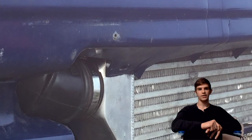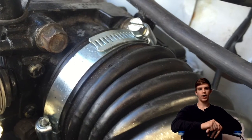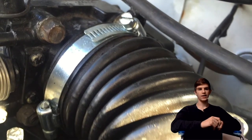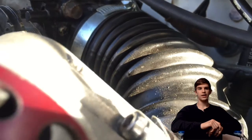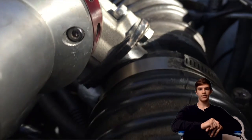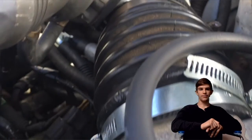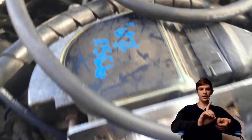Make sure the mass airflow sensor is on the right way — it's on the pressurized side of the intake. I got an Apex blow-off valve that came with a kit of turbo stuff I bought. The intake is cobbled together, it barely fits, but it fits, and the front mount looks pretty cool.